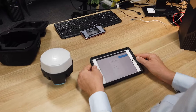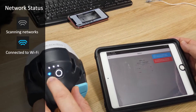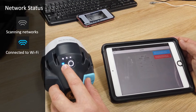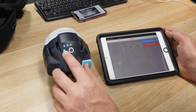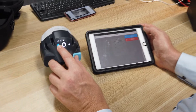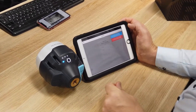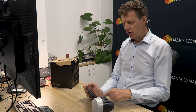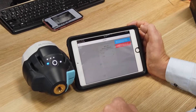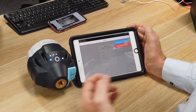We enter the password for the WiFi network. You can see it's successfully joined because the WiFi indicator stopped flashing — while trying to join another network it flashes blue, and once it goes solid blue it has successfully connected. It's really easy to make a typo when entering your WiFi password, and we get a lot of people contacting us saying their unit won't connect. When we debug it, it's almost always a typing error. If that happens, go back into the updater software, delete the known WiFi network, and carefully recreate it.